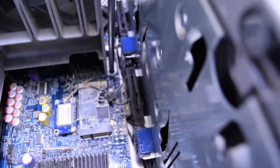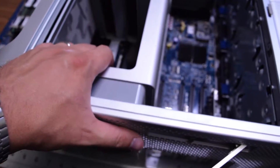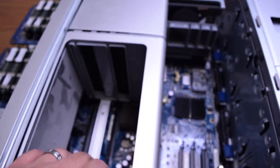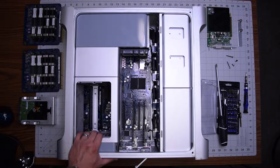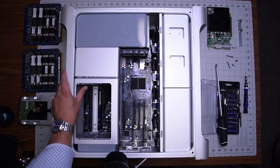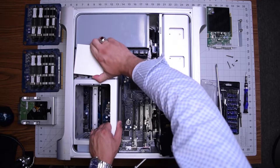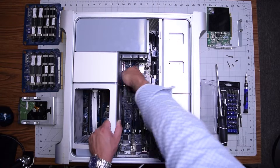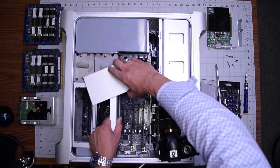Now let's remove that one Phillips head screw securing the fan. With the four screws removed, you can see when I squeeze down I can actually move it and there's some playroom. We want to squish together the frame and the case with our hand — squeeze it. See that little crack it creates? Once that crack is created, you can pry out this middle piece. It's a little challenging; you've got to wiggle it around, but it should come right out.